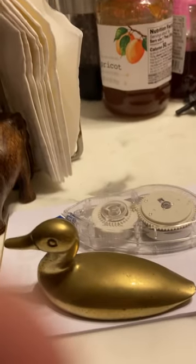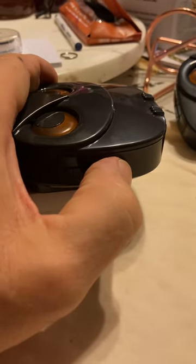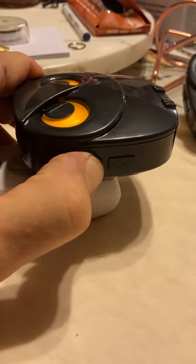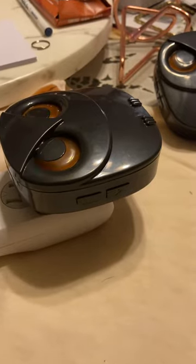Repeat for receiver number three. Select the tone and cycle to garage. Press and hold the volume button. Note: if you accidentally pair to the wrong tone, go back into setup mode for garage and redo it. Enter setup mode, create motion, confirm garage tone. Test it — there you go. Receiver number three is configured for garage.